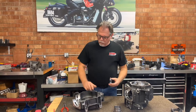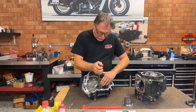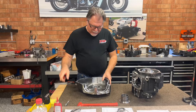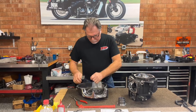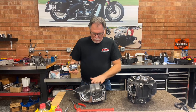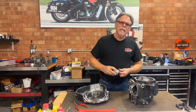Once all this is in, we start with the insertion of the snap ring. This is a Jim's tool that we use — we crack this and squeeze that real nicely, and just put that in there like so. That sets the snap ring. Then I'll take that off and take a little brass punch and just set that, so it will be in the groove that has already been machined in the insert. Then I'll show you how we press them in on the press, and we're just going to go step by step so you guys can see what we do. Thank you very much.